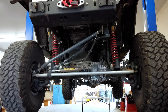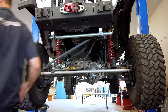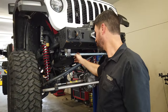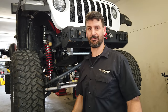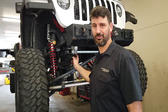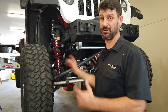I have the mounts in place normally where the factory sway bar would have mounted, but I put these 3-inch aluminum blocks in place. That's because we have the Hamburger supercharger installed, and the oil cooler for that supercharger is right where the normal factory sway bar would have gone. So we had to put these big blocks in. I had to search around town for some metric bolts that were long enough — I needed some like 140mm long and couldn't find any, so I ended up buying some all-thread. I'll replace all this with some grade 10 metric hardware at some point, but I want to go wheeling, so I'm putting this in place for now.